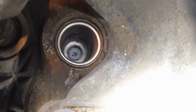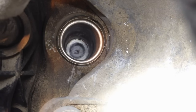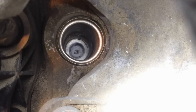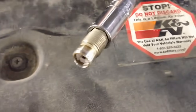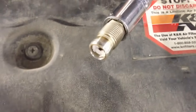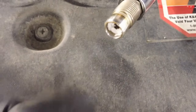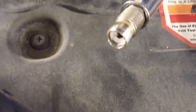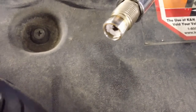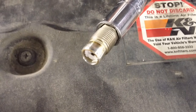It's filled with porcelain, so there are a lot of little chunks in there, and the center electrode is stuck down in there too. We're going to blow out the cylinder and start the extraction process with the Lisle tool. There are multiple ways a plug can break — you may see porcelain up to the top with the center electrode sticking out, or the whole plug intact except for the shell missing. The most common is the center electrode and porcelain flush in the cylinder, which is what this tool is made to handle.